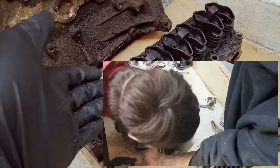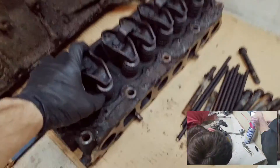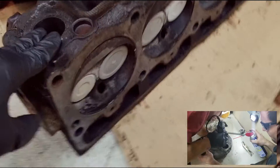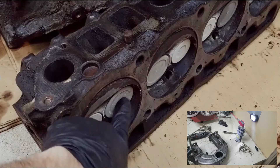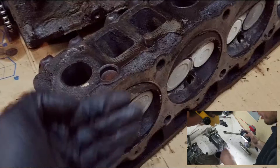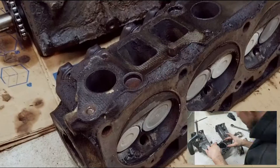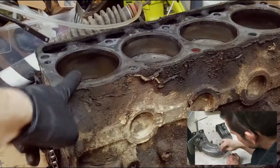While you're watching this little montage, I'm going to explain what's happening here. So this is a cylinder head, and these guys control valves. In here you have two valves — an intake and an exhaust valve; the intake is the bigger one. Now the amount of air that comes into your cylinder is not controlled by the throttle body so much as it is this valve, because this is the last stop before it gets into the cylinder.